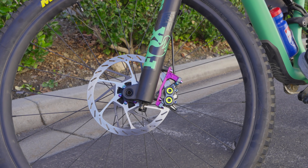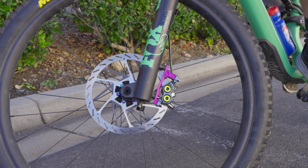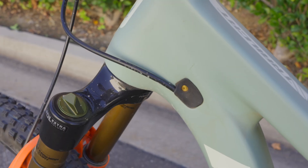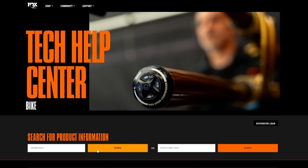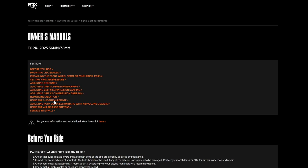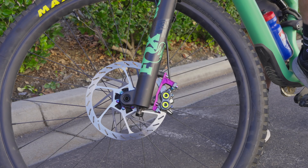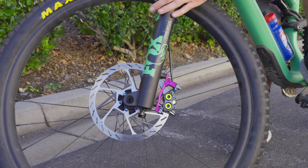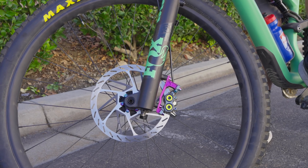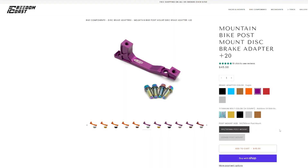Now that we've covered the basics, let's figure out how to find what size brake adapter we need for the fork on this bike. If you don't know your fork's minimum rotor size, you're going to want to look up the serial number located on the back of the fork crown on either RockShox Trailhead or Fox serial number lookup. This will give you information about your fork — either a part number or just flat out telling you the minimum rotor size. From there, take your desired rotor size. In this case, we want to run a 200 millimeter rotor. We're going to subtract 200 millimeters from this fork's 180 millimeter minimum rotor size, which is 20 millimeters. So that means we need to run a 20 millimeter post mount spacer in order to run a 200 millimeter rotor.